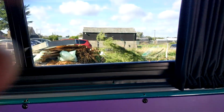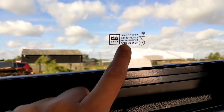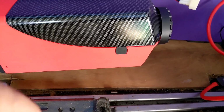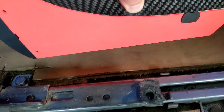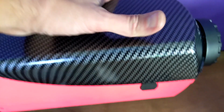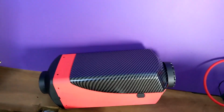Now I took a marking off the window. I looked on the outside, and underneath there is a lot of space for pipes to go down, so I need to make sure that's pretty much central. And with the chair in place, I'll get about 1 inch gap on the side of the unit, so that's a good template for me.